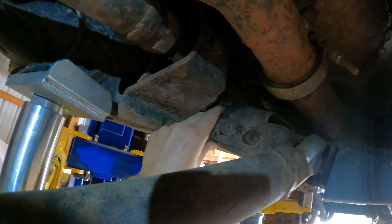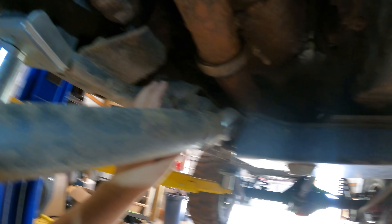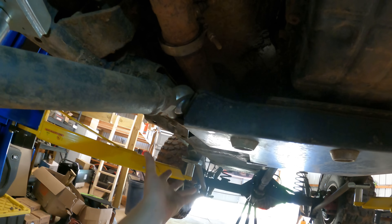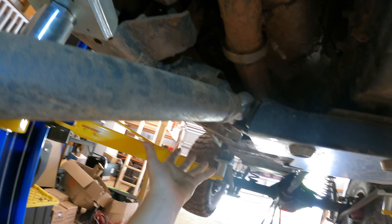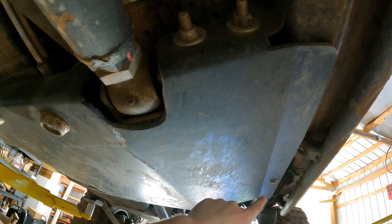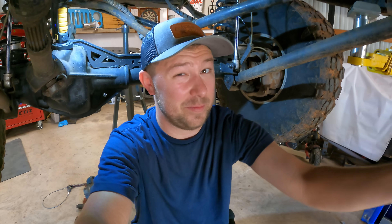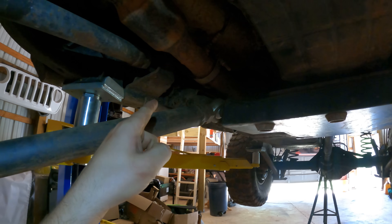What we're going to do is support this mount to prevent it from cracking further. We're going to weld a plate on here and structurally brace it into our upper control arm mount or along the frame. One way to prevent this would be a skid plate that incorporates over here, such as the gas tank skid plate — for example our transfer case skid plate that actually ties into the forward crossmember mount and onto the frame. If you're running something like this, I suggest crawling under your Jeep and not only checking the factory welds but making sure you don't have any cracks.